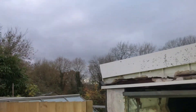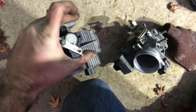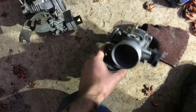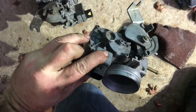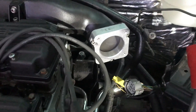It's starting to get dark, a few days since I was last working, and it's spitting slightly. I wanted to mount the throttle body — that's the new one, and that's the original, but its socket was cracked and the TPS isn't for a turbo application. I think I robbed that TPS off the 420 GSi. So basically I have a good used TPS and throttle body with the stepper motor idle valve, and I'm going to fit that onto my alloy intake pipe.